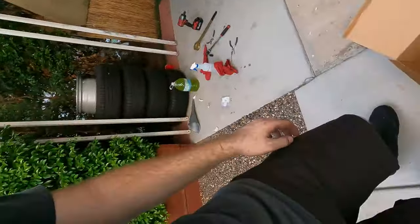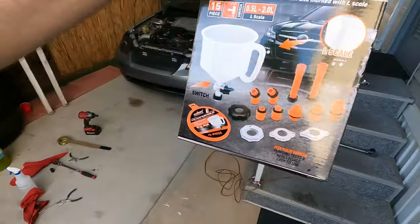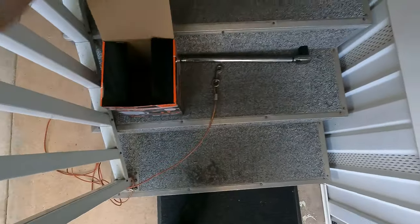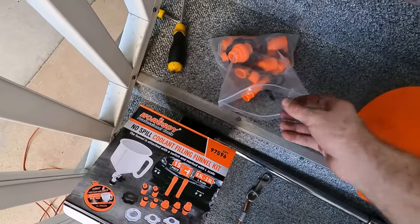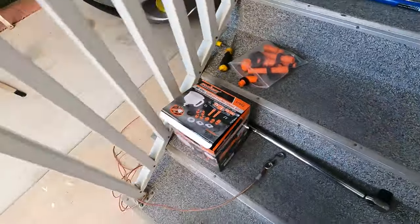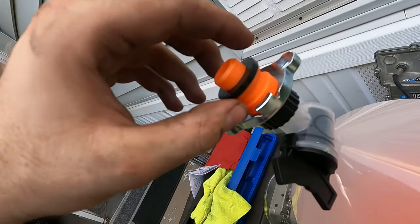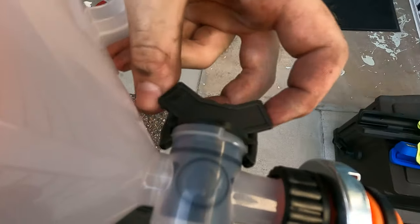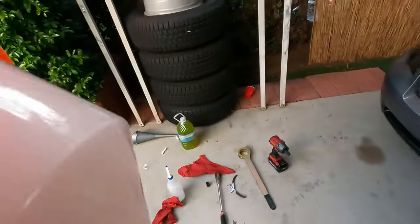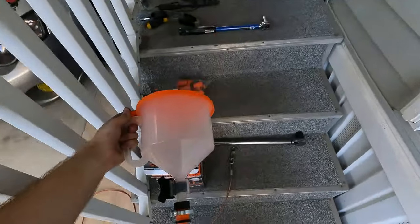The one tool you're going to need is some sort of no-spill coolant filling funnel. This one I got off Amazon — I can link it in the description below. You can also get these at AutoZone or pretty much anywhere. They come with this funnel and a bag of adapters, O-rings, and caps. Some of these have a valve like this one, and some have a stopper you just stick in. I think the valve works better, so I got that one.